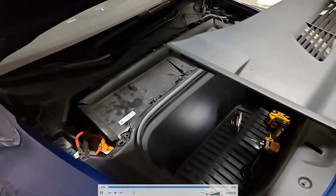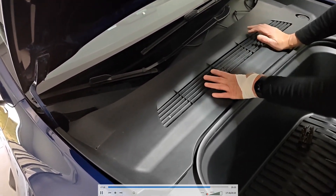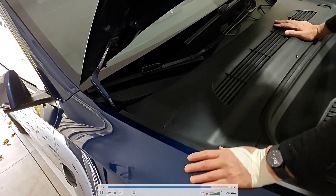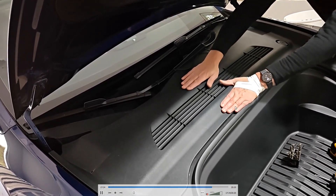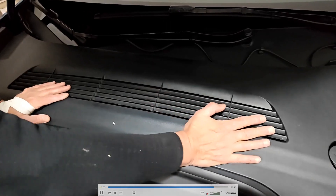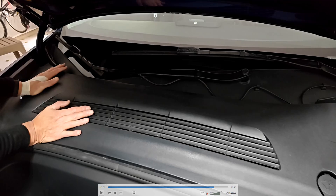The last thing to do is take the top plastic piece and snap it into place. It has those white pins all the way around — just line it up, and when you push it down it should make a clicking noise. The pins on the outside are a little easier to push in than the ones in the middle area, which can be a little trickier, especially because there's some flex in the frunk. Don't worry too much if a couple of them don't give you a full clicking sound — when you close the frunk, the gasket should secure this area down and may even help push those front pins into place. Once those pins are set, you can shut your frunk and you're good to go with your new HEPA filter.